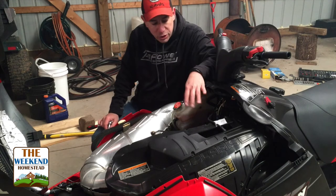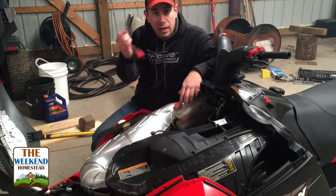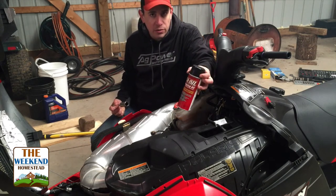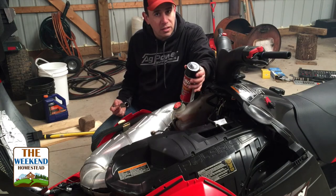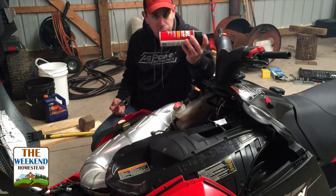Next step is engine compartment. We're going to take care of the spark plugs and the oil. We're going to use a socket. And then I use this stuff called stabil fogging oil. We actually fog the cylinders and make sure that they're well coated so they never rust, seize, or have any issues at all. So we'll get the spark plugs out and we'll spray this in.